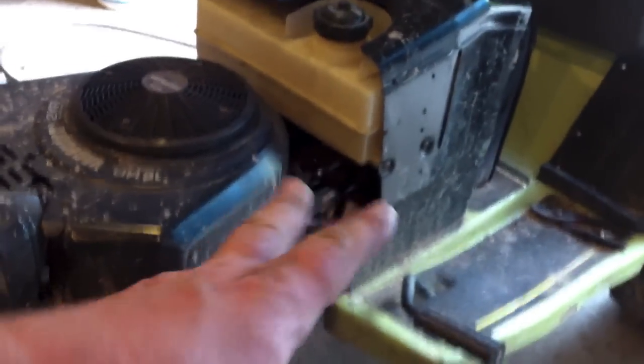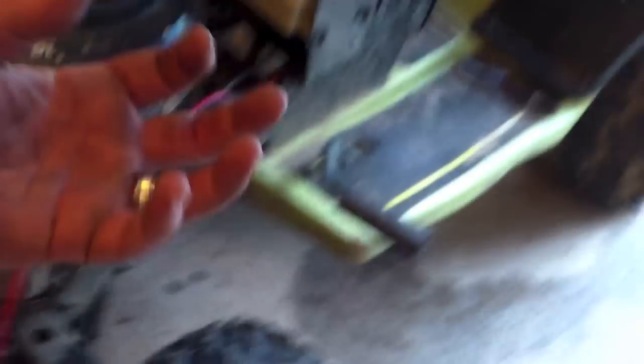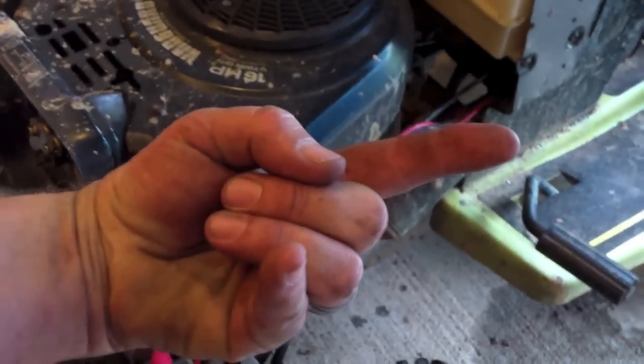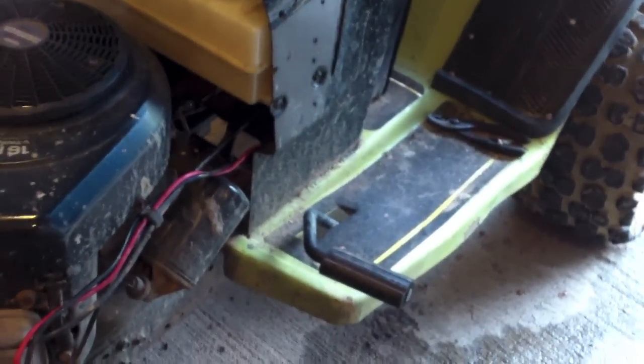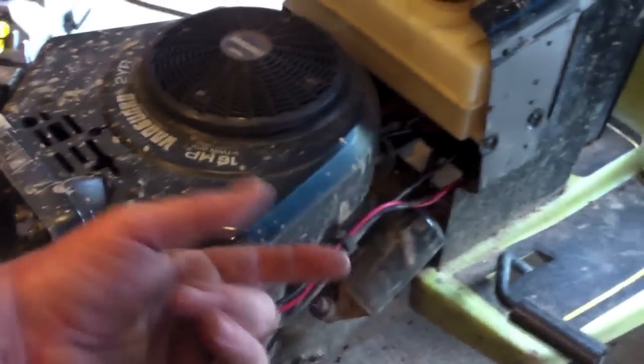I think I've come up with a solution to the problem. Still gonna have to pull the floor pan and the console off so I can get to where I need to. What I'm going to do is — my double pulley double clutch setup has three-inch pulleys — I'm going to offset them and put four-inch pulleys. That will give it more pull, less slip, and allow me to work with a 92-inch belt, because the 90 is too short, the 92 is too long, and there's no more room for any other pulleys. I think that will take care of it hopefully.